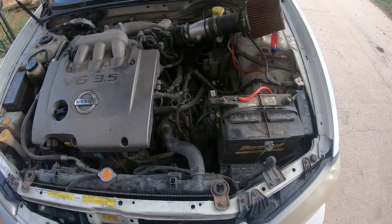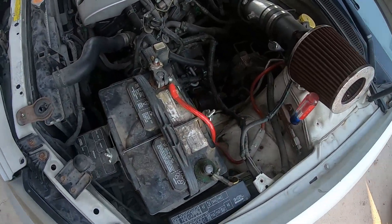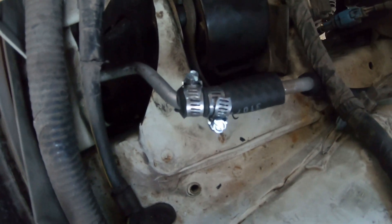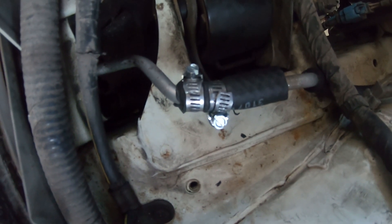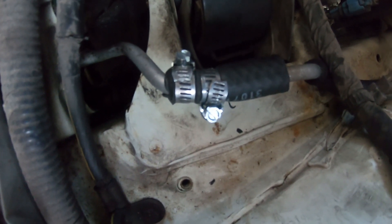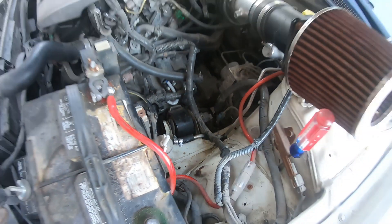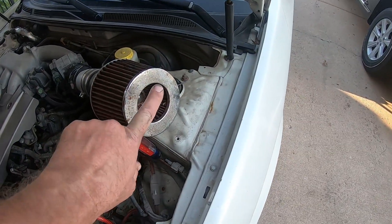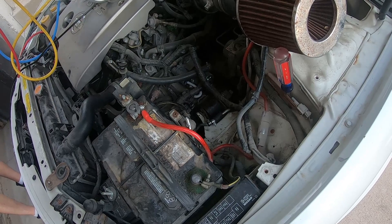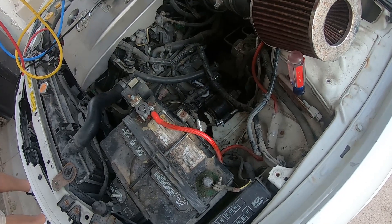We've just recharged it. The compressor is fine again, everything is nice and cold through the vents, and it took just the right amount of Freon. There are no suspects anymore — we're expecting to see leaks if they appear. It's got the hose clamps and hose around the JB Weld, doubled up and super tight. I've heard nothing so far. By this time yesterday it was already leaking after the line got jostled. The leak is so small, but as you know, any gas will find a hole if it's there.